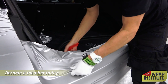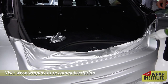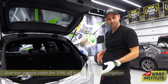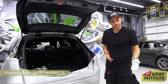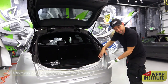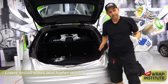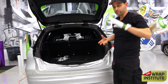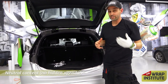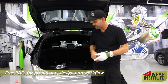Not using the heat gun means I don't over-stretch the material, there's no tension on the edge, and it's going to hold long term. Double check the edges and cut everything off as normal — the cutting system doesn't change, it's just the technique. So if you've been doing 50/50 for years, throw it out when you get to the back bumper. Now you do 30/70 and then at the corners you do zero/100, which feeds them out. Changing the analogy — calling it a mouth instead of a scoop or pocket — makes you see it completely differently. I hope this helps you wrap back bumpers quicker, better, and faster in one piece.